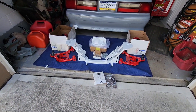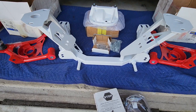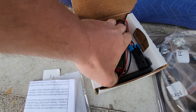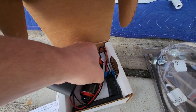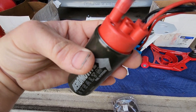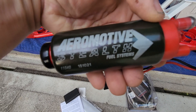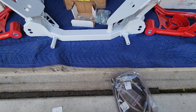So here we have it. We got the Vortec on, so now that we have the Vortec we need a little bit more fuel. We got an Aeromotive 340 Stealth pump that we're gonna install. Since we got the 42 pound injectors, the bigger mass air, and a supercharger, we need something that will keep up, so we're gonna install this into the fuel tank.